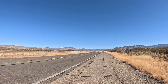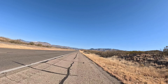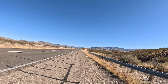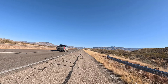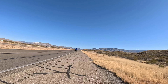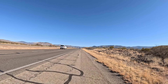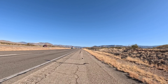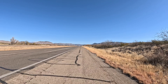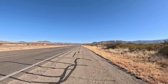I'll talk a little about an equipment issue I've been having recently. I've been running tubeless for a while with these Shimano Ultegra wheels that I've had for quite a while — at least five years. I've really enjoyed them, they're very durable, only had to have them trued once. But I do run sealant with tubeless, and these wheels are so old that technically you weren't supposed to run sealant in them because it can corrode the rim — and that has actually begun to happen. It's mostly centered around where the valve stem goes.